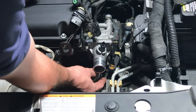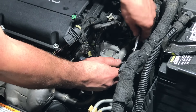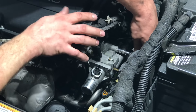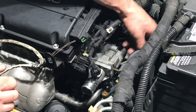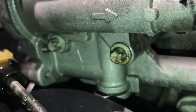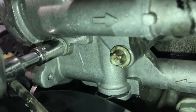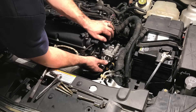This coolant pipe goes to your oil cooler. Once you take these bolts loose, the pipe will be a little bit loose — that's normal, it'll still seal fine. Next, take the four bolts off the thermostat housing that attach it to the cylinder head — two on the top and two on the bottom. These bolts are a little bit longer than the first two. Follow along the side of the cylinder head to find the other two bolts. It may take a little working around — you might need different size extensions, maybe a mirror to see in there. Once you've got all the bolts out, the thermostat housing comes right out.